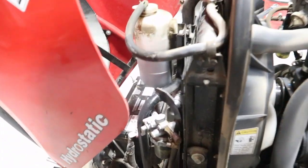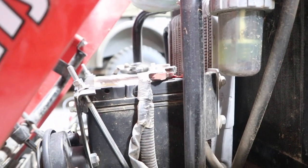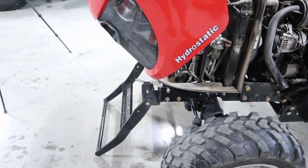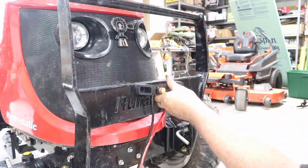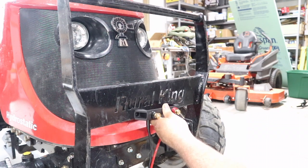Here you can see right at the front on the floor is the battery, and the terminals are fairly conveniently located on the top — that's what I've got to connect to. I need a convenient place to mount the extension, and I think the most convenient place is going to be on that brush guard. I'll make sure however I hook this up it works in the up or down position. I'm going to put it on the front right here in the middle — I simply need to drill out two holes and insert two bolts and we should be good to go.